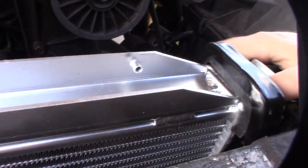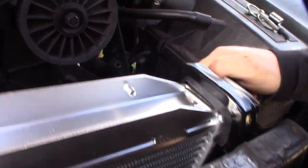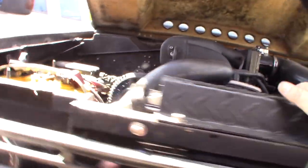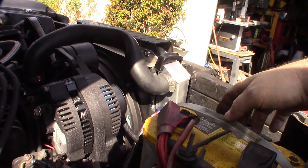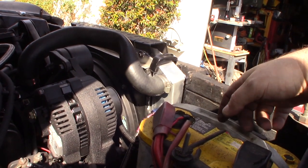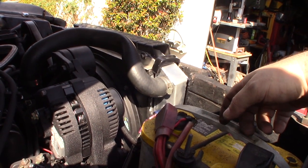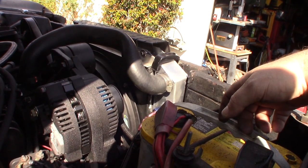The main thing is I just don't want this thing to be rigid — I want it to be able to flex as the car moves around. All right, I've got this thing back together. If you want the ultimate fan, get that Volvo fan — it's basically a Taurus fan but without the big shroud around it. It's awesome. It really cools this thing off; I never even have to go into the second high speed — the single speed is perfect.